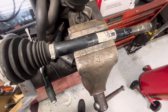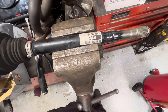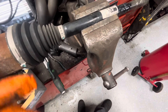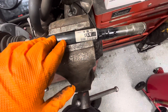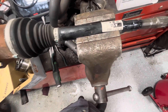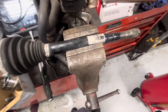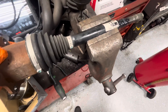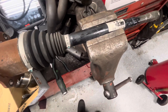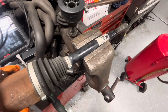You're better off doing this yourself when you can. Unless there's no option to buy the CV joint kit, it's always best to service what you've got. Also worth noting: if the axle has already been replaced with an aftermarket one and the boot is torn and joint is bad, you'll probably have to replace it with another aftermarket unit — you likely won't be able to fit a factory CV joint onto a cheap aftermarket shaft. Fixing up the original is the best option; replacing with a factory axle is another, but that gets expensive. Thanks for watching.